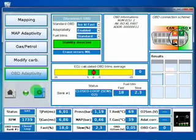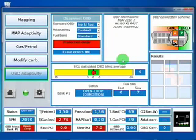Okay, we are running on the road now, we're moving, so we can see if OBD adaptivity is working. And we have a little bit lean mixture, so the results map is increasing, as you see. If you can stay steady in a single point, you will see that the ECU will bring the red circle, that means the average here, back in the green square. So that means that the fuel trims are running in the right way.